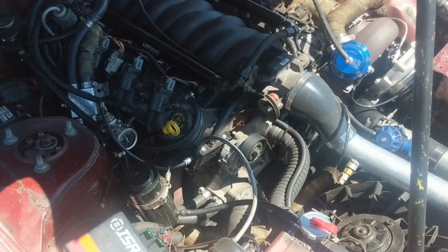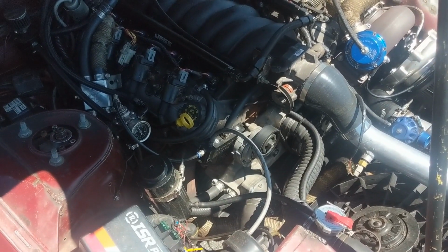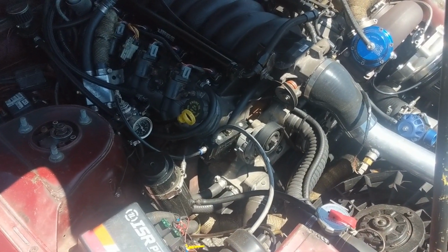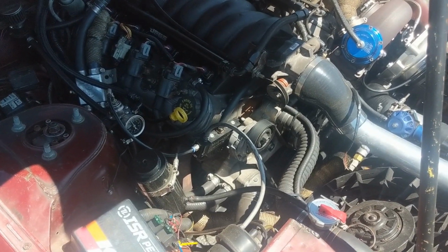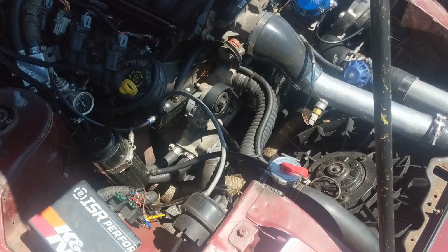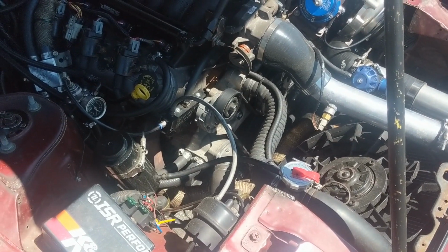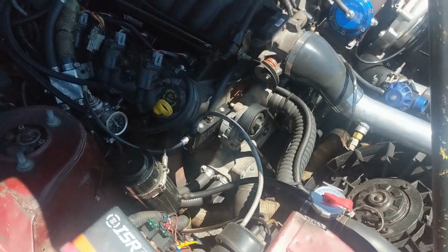It's just basically stock. All I did was pull the pistons and rods out. I checked the ring gap. They were all pretty good, opened up for boost. Put a Summit Stage 2 turbo cam in it. I kind of debated between that one and the Sloppy Stage 2, but the Summit cam was cheap and it's hard to find the Summit or the Sloppy Stage 2, so I just went with the Summit one. I like it, it's good.